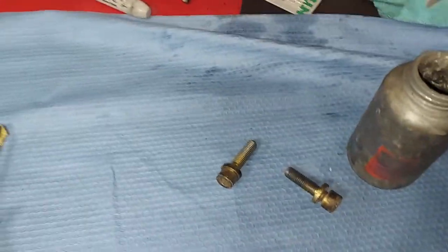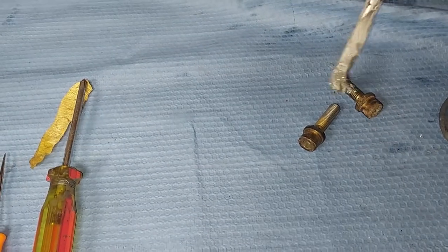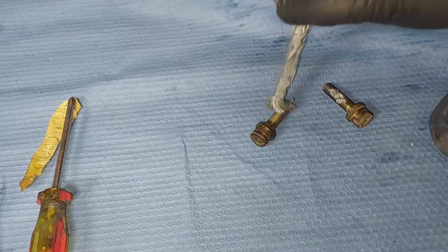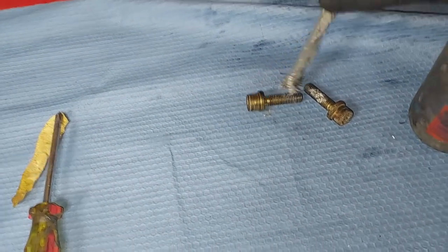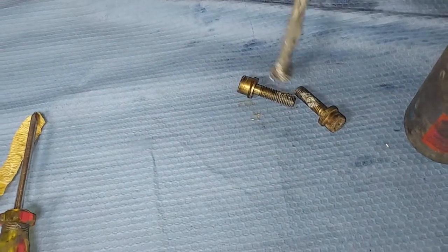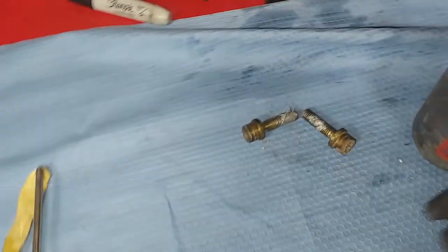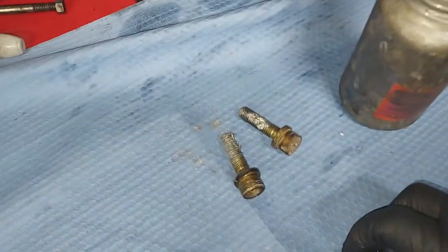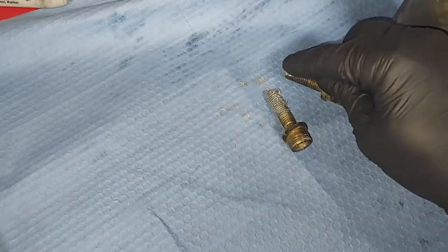Okay, I always put some anti-seize on the bolts before they go back into the engine arms through the engine mounts, because I'm doing this one-handed, guys. Just get it dabbed on there. This is a steel bolt going into an aluminum housing. So always throw some anti-seize on there first, just to make sure these never get stuck in there.